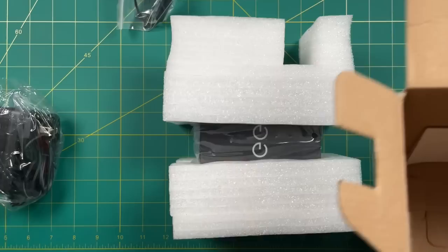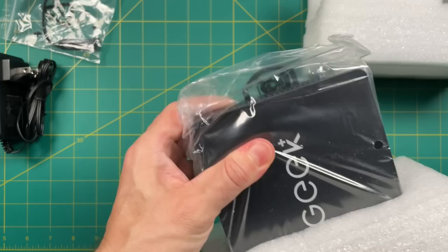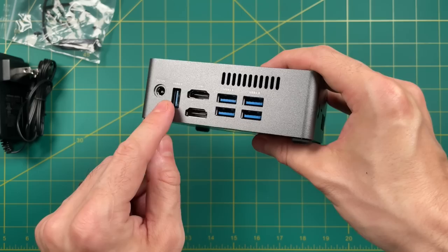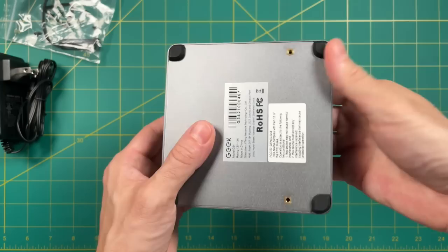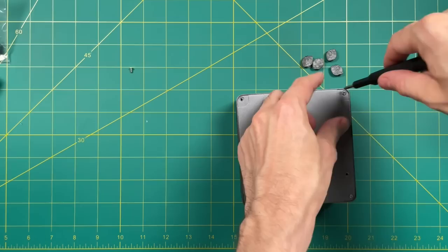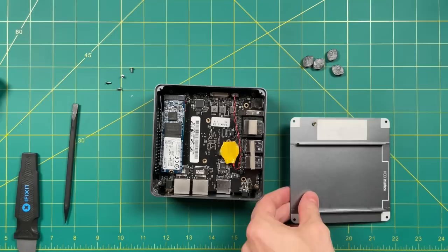Not a lot of frills when it comes to unboxing — it basically comes with a power supply, the PC itself, and a connector for the other hard drive. What I like about this one is that it has five USB ports, two HDMI out, a microSD slot for additional storage, and dual gigabit ethernet ports. There's ventilation on the sides but no active cooling, so it's going to be a silent PC. To get inside, you remove the feet and use a precision screwdriver on the four screws. It's a little tricky to get the bottom cover out — easiest with a small screwdriver for leverage.